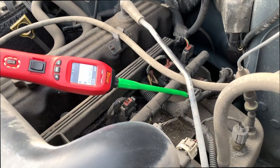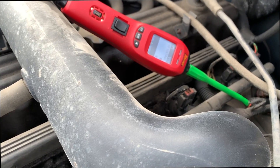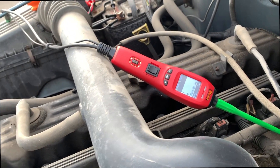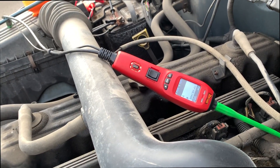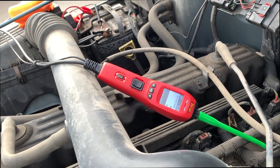When we cranked it over to attempt to see — just bump it over, just one turn — we're on the crank position sensor wire, the gray and black. We bump it over, looking for a five-volt signal. Bump it — nothing again.